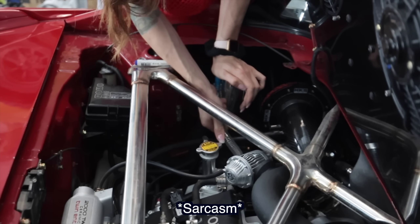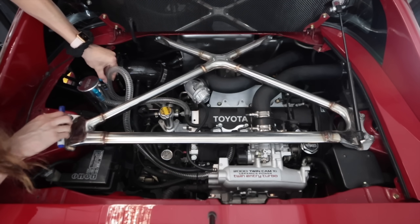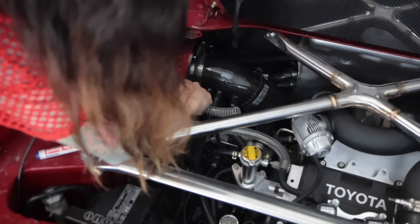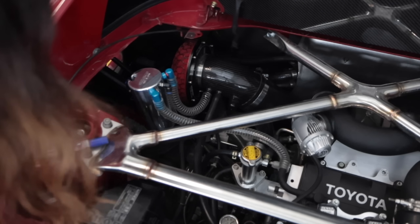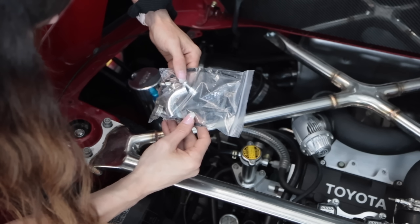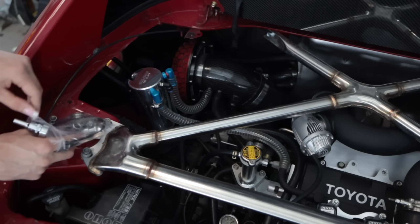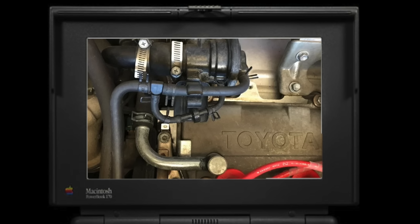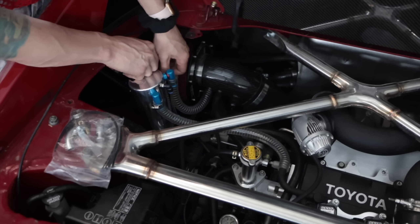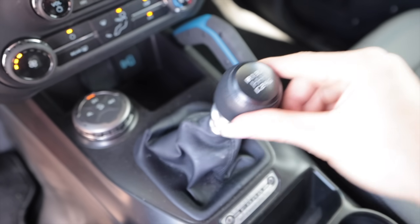I don't know why I'm so obsessed with this translucent blue tape. Those dry erase markers smell weird. No lube was not a good idea. For those of you that are a little bit confused on the purpose of an oil catch can — where most vehicles do have a PCV valve, on these second generation turbo MR2s they just had a hose that would ventilate the crankcase vapors back into the intake track. So this vessel collects any of the oil vapors, so it's easily dumpable rather than putting it into your engine and gunking up your intake valves and turbo.